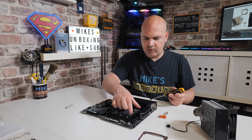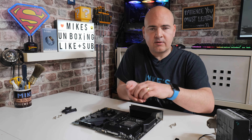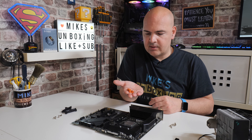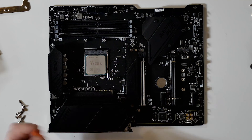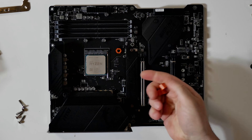When you've removed all four screws, remove the two plastic top pieces as well, and leave the AM4 backplate in place. Next, grab the four orange spacers and put one over each one of the protruding parts of the AM4 backplate.